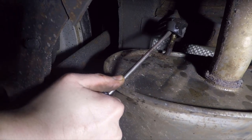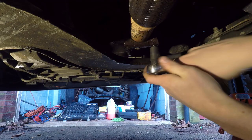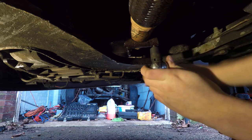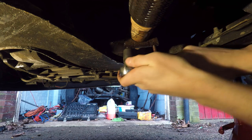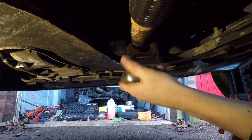This one's got WD-40 on and look how easily that one comes off. Then get a 13mm socket and undo the two nuts on the U-bolt for the exhaust clamp at the front. There is another one of these just in front of the rear wheels — you want to take that one off as well.